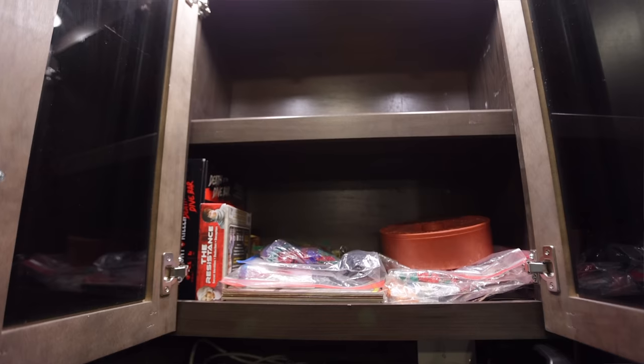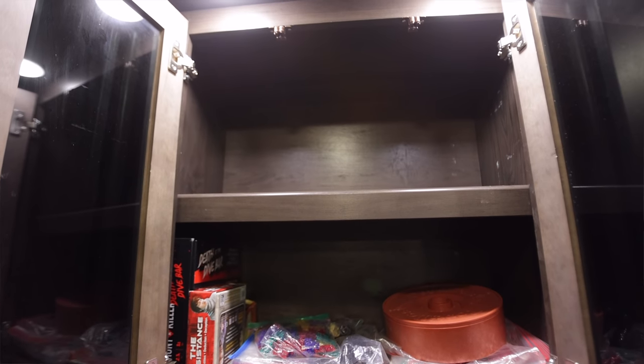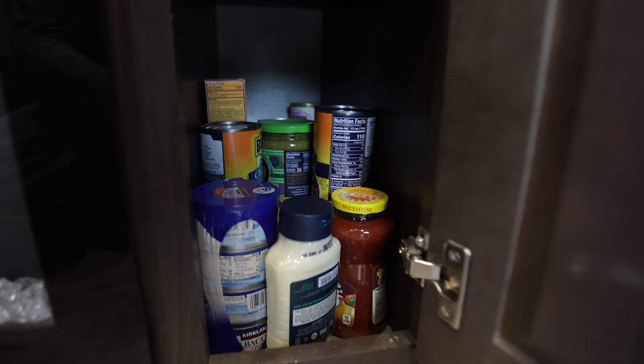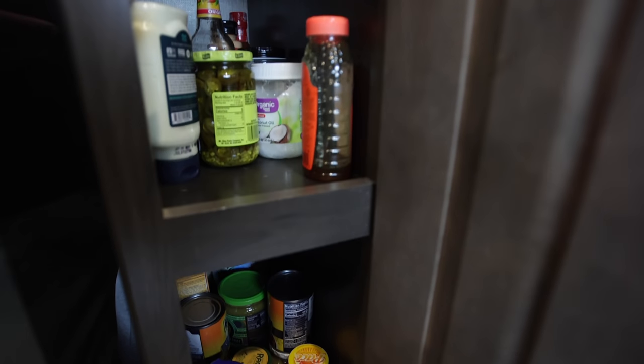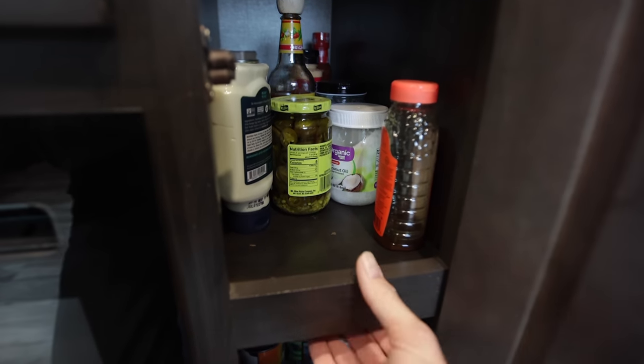This applies to other areas of the RV like shelving. These RVs are built to be light and to use inexpensive materials. When you look at the shelves inside the RV, it's a very thin piece of plywood — more like a lauan — and when you're placing cans or grocery items or larger items on these shelves, you want to think about whether that's a weak point you're stressing. We keep heavier cans on the floor, and we try to keep that thin shelf from being overloaded, because on drive days there's movement as you go down the road and we don't want extra stress damaging the cabinets.